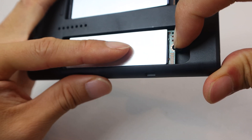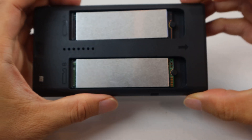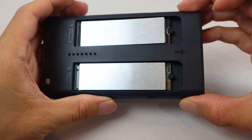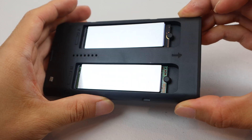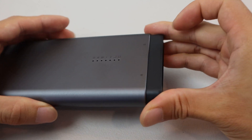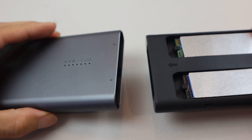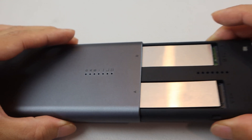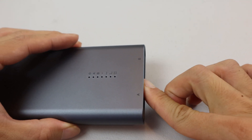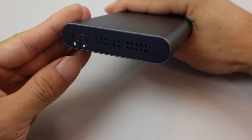Keep in mind that if you plan on cloning the drives, be sure to install the source drive in slot A — the drive you're copying from — and the destination drive in slot B — the drive you're copying to. The drive bay only goes into the enclosure one way, so make sure to insert it into the aluminum housing arrow side first. Once clicked into the housing, slide the tab to lock it to prevent accidental ejection.